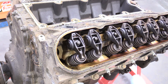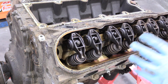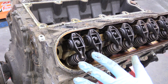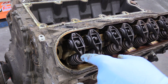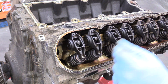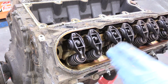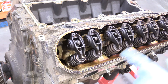In order to get the heads off you're going to have to remove your valve train. What you need to know is this valve train has a roller trunnion but a standard non-roller tip. If you're going to reuse your valve train, make sure all of it goes back together the way you found it. Each rocker has to go in its position with its push rod in the correct orientation because those metal surfaces get used to wearing together — if you change that you can cause premature wear and you'll be taking this whole thing apart again. Same thing goes for lifters, but we'll get to that soon.